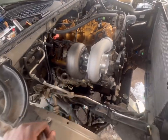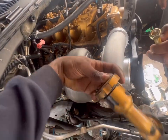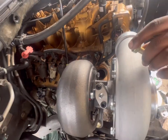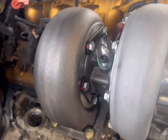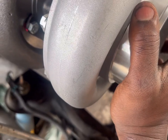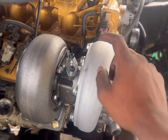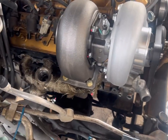We're mounting the turbo right now. This piece right here was in the way, not allowing the turbo to sit flat, so we're going to figure something out on this side unless we flip the whole thing. We wrapped up the exhaust manifold - doesn't look too good but doesn't look bad either. We clocked the turbo - you can rotate it - we want to make sure it's perfectly horizontal, and we're going to have the outlet pointed straight down.